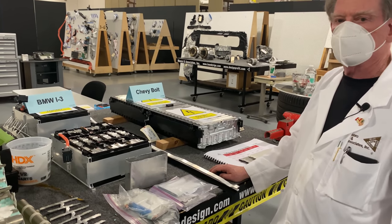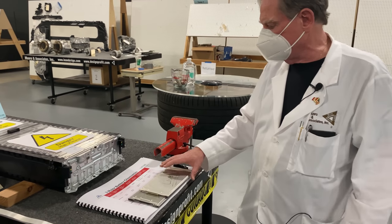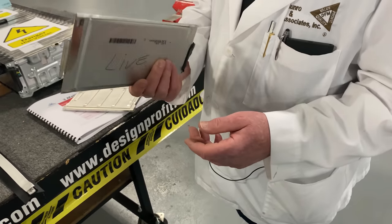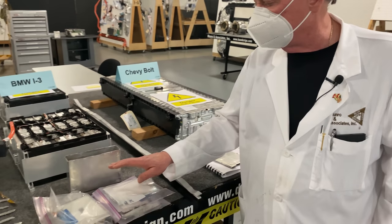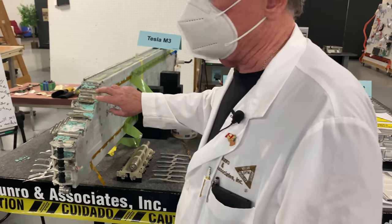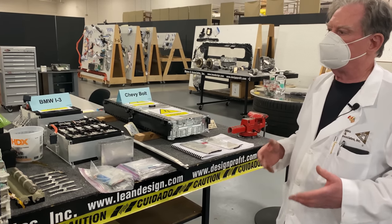This is an older style. Many people have gone and taken this a few steps further. This is Samsung's idea. So this is LG, and this is what's in the Chevy Bolt. So the Chevy Bolt uses something a little bit different — these are called pouch cells. The pouch basically fits inside of here, and you'll see that there's a little trailing edge on these. What they are is they're bent in a serpentine so that each pouch is connected to the pouch next to it. When you get all done looking at this, you find out that this is the most expensive way to do the individual cells. This comes in second as being a little bit less expensive, but these are cheap. You can make a jelly roll battery by the thousands in a very short period of time. This one takes a lot longer to build up the pack itself, but it's the most efficient as far as space and weight is concerned — you get better density here.